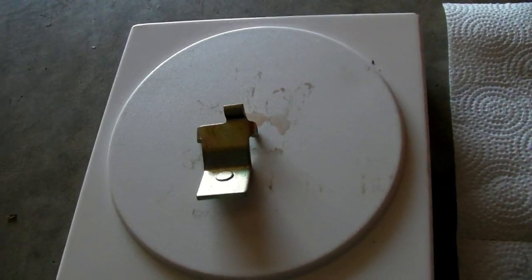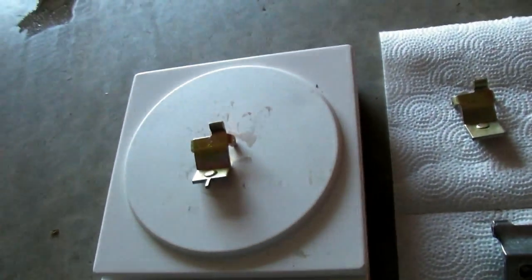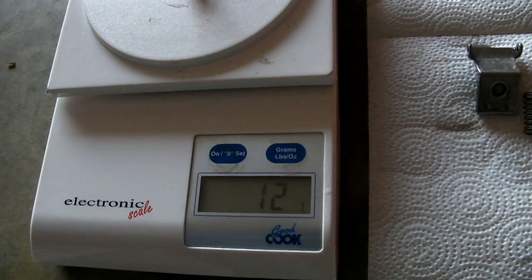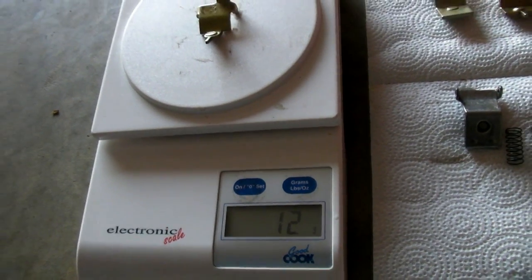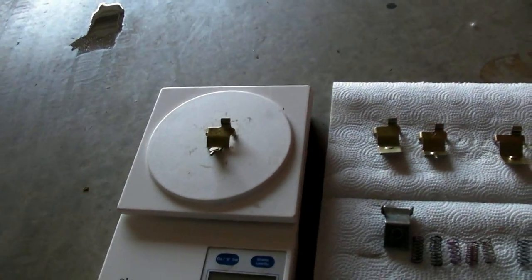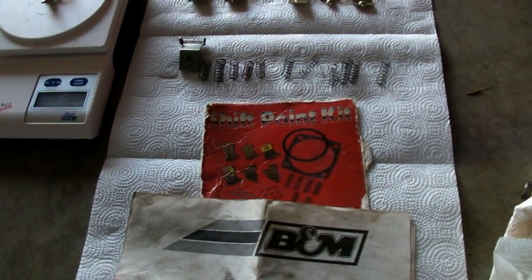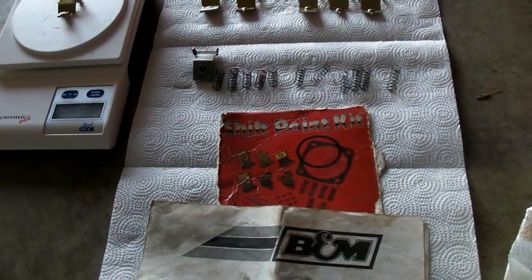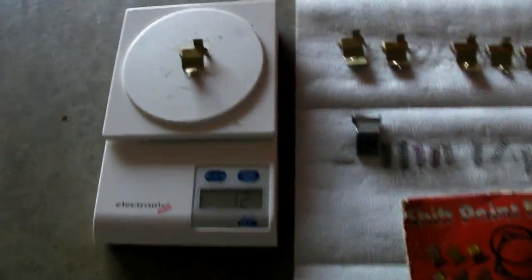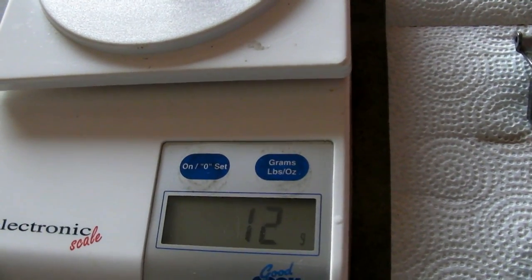The number one B&M weight is also 16 grams. Number two is 14 grams. Number three looks lighter — that's about 12 grams. The weights make a big change and the springs are fine tuning. I'm going to go with that number three weight. Right now it's shifting from first to second at about 4,200 RPM, and I want to bring that up to about 5,500 RPM. So I'm going with this weight — it looks like it might be more like 11 grams, alternating between 10 and 12 on the scale.